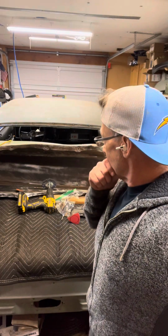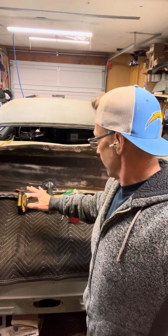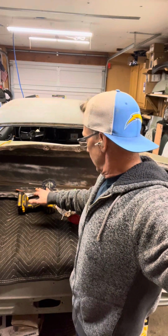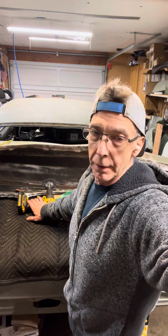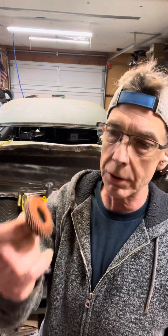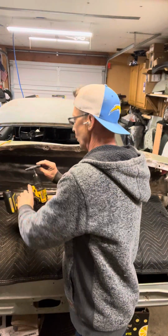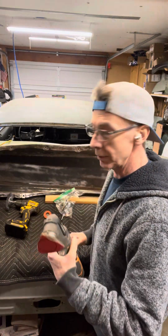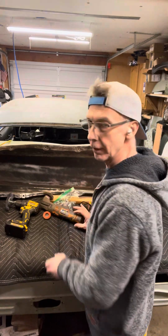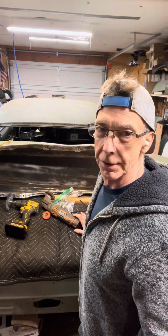Anyway, working on this fender, still the underside, doing the rust cleaning and getting it all de-rusted, using just about every tool I can find in the book to get it off of there and get down in these grooves with these little 2-inch discs that are 12 bucks a pop at NAPA. Nylon wheels, wire wheels, air tools, drills, just to make it go easier and faster, but it all boils down to elbow grease and it just takes time.